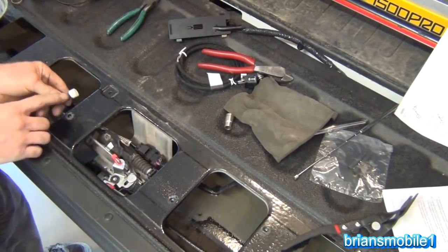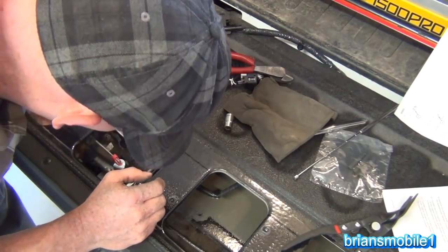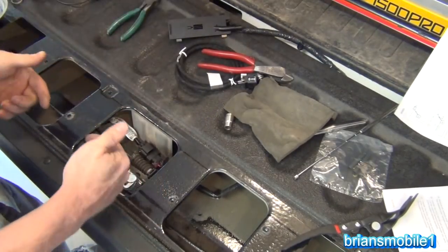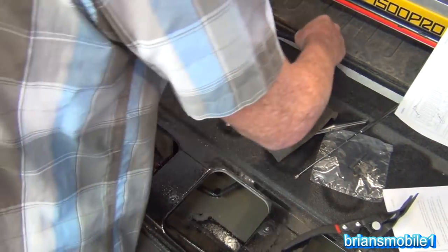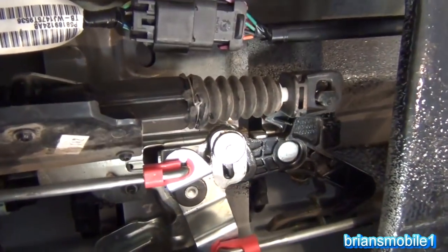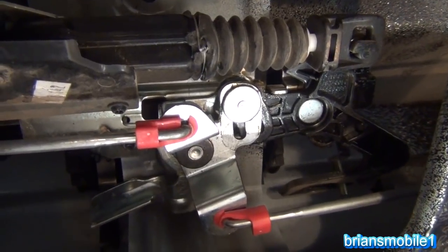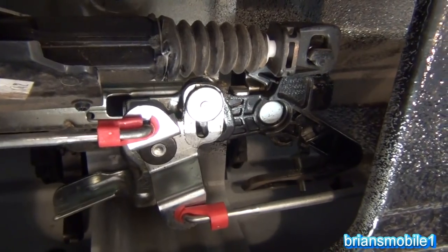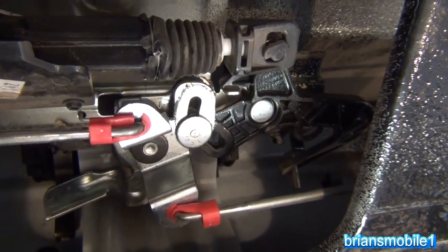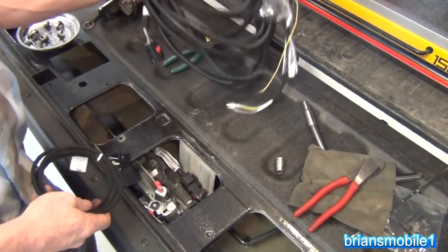This is important: there's a little green line here and there's a green line on the camera itself for the plug. So basically where all the latches are facing you if you've got the tailgate down. We're in; that part's done. This is the lock for the tailgate handle — the instructions say you have to pull the wires out and manipulate it if you do have a power locking handle. I didn't do any of that, and watch — you can see my power lock's still working. We are just up and running; the tailgate camera's in.